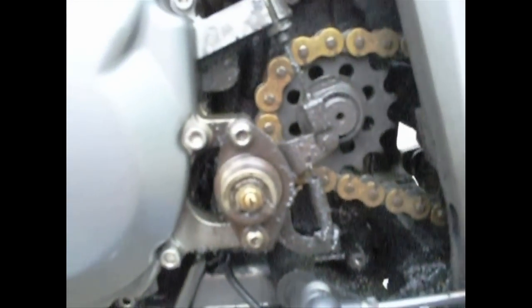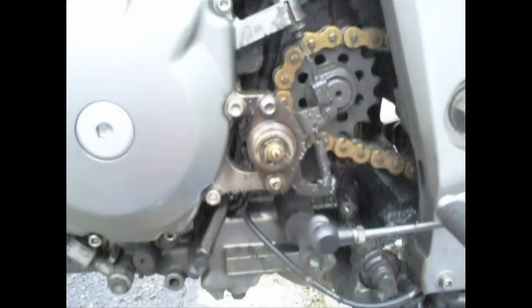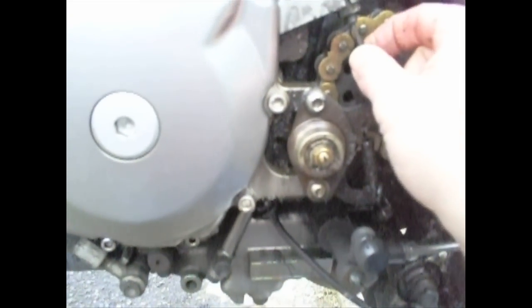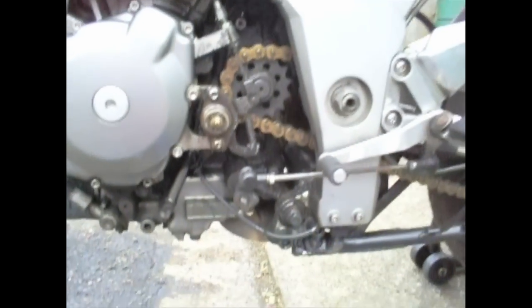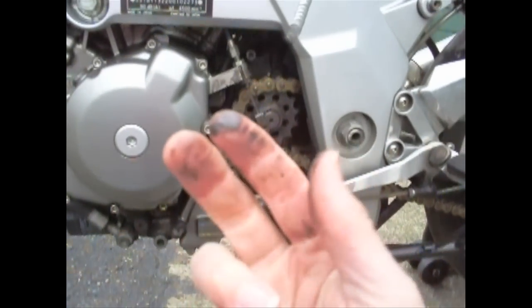What I'm going to do is remove this part here — I'm going to disconnect this cable from here. This is the clutch cable, and this is my worm gear mechanism. I want to take this off and make sure it's running with lots of grease. Behind there you might just be able to see the push rod, which goes from the worm gear to activate the clutch.